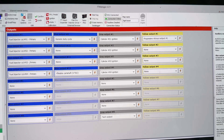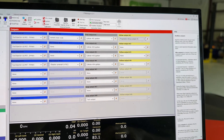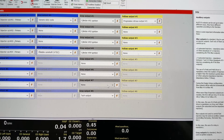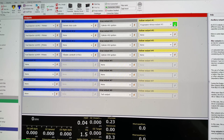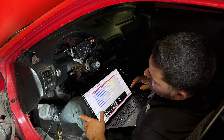In our FuelTech software, we have yellow output one, which is set to progressive nitrous output. That's the table you'll be using for the clutch valve inside of FuelTech software. If your ignition is on, you can click this right here, and while you hold it, the solenoid will be powered. We're on that table right now where you test your outputs, but this is no clutch slip.